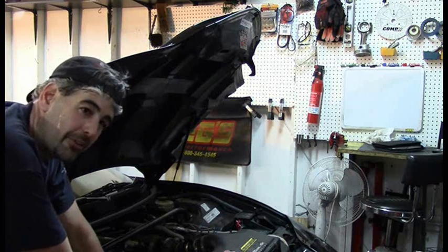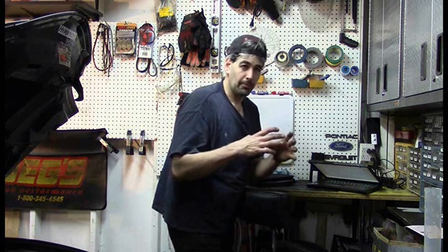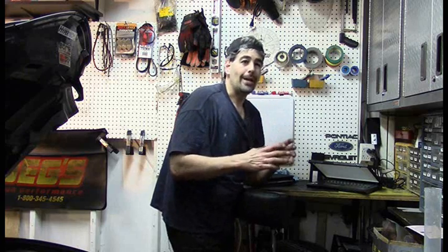Let's move on to something I've never done before. Back when I used to do cars more often, I was at the salvage yard all the time and there was a guy named Cedric who pulled engines and transmissions. He used to do a test he called the sizzle test: take a piece of aluminum foil, heat it really hot, then dribble some oil on it. If the oil sizzled — like when you add water to oil in a frying pan — then he said the head gasket has to be blown because there's water in the oil. If it just smokes, there's no water in the oil.